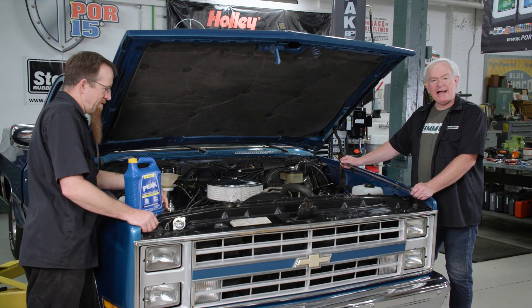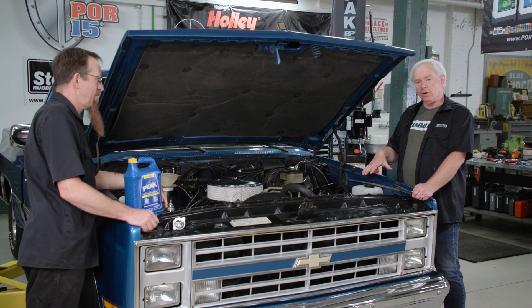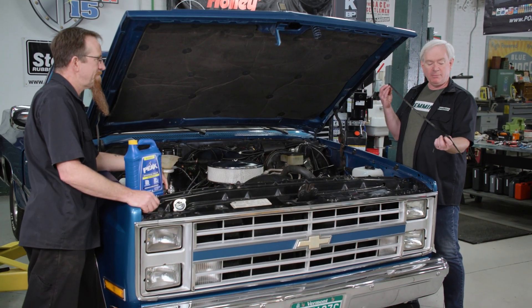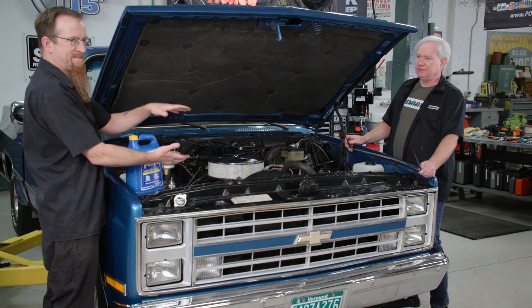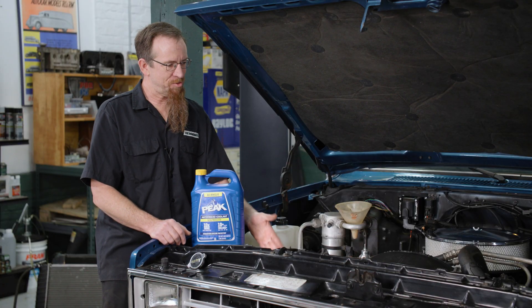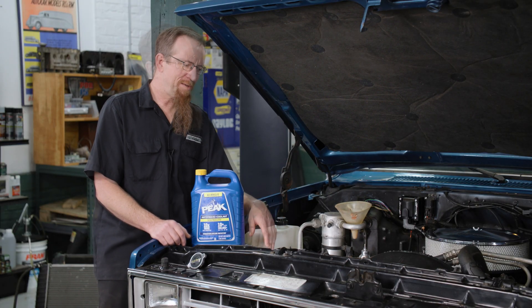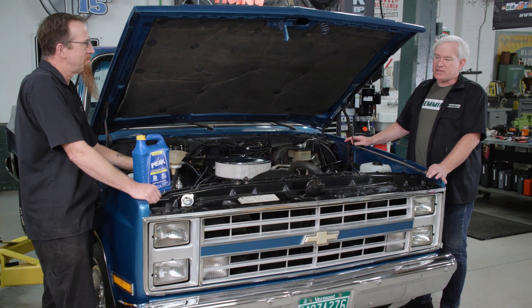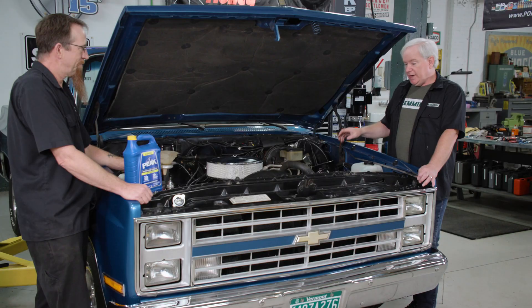We got this thing pretty much bolted back in. One note: we did discover after we put the fan shroud in that it was rubbing on the core. This is a three-core, remember — we had a two-core in here before. So Junior just cut off the bottom of the shroud. It looked like it's a two-piece that's stapled together and over time it just heated and warped, so the bottom of the shroud was right up against the radiator. He trimmed that little half inch off the bottom so it would bolt up, and now it sits nice and flush with a very minimal gap to the radiator. So a good thing to always check when you're putting a new radiator in is make sure the shroud is not rubbing right on the fins and the tubes.